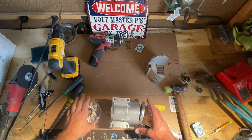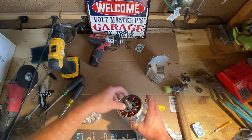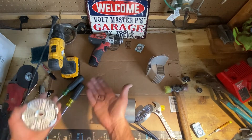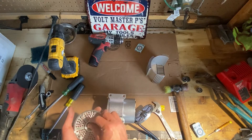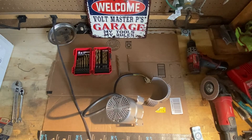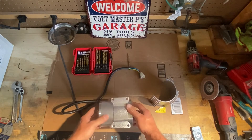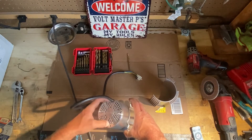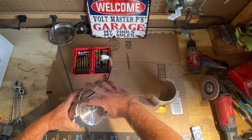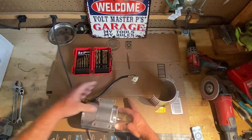We are putting it back together now. The holes are drilled, we've got the new bearings in there, everything's cleaned and shiny with the Brillo pad, everything's blown out with the air compressor. One thing you need to make sure you do is put this little washer — don't lose it — on the sprocket side when you're sandwiching these back together. The motor is back together. When putting these caps on after drilling them, you want these two threaded holes to match up with the other side. You could put it on and have the holes misaligned and you wouldn't realize it until you go to put the bike on, so these need to match up.